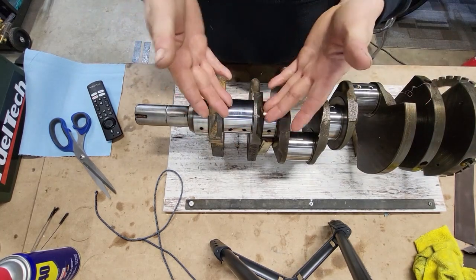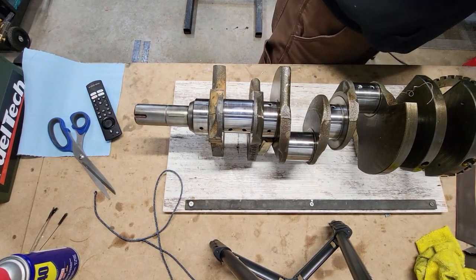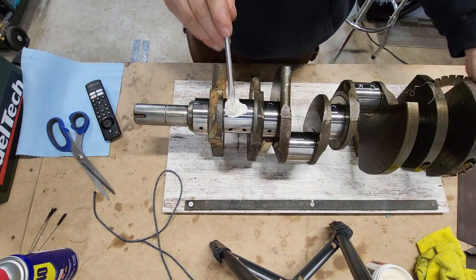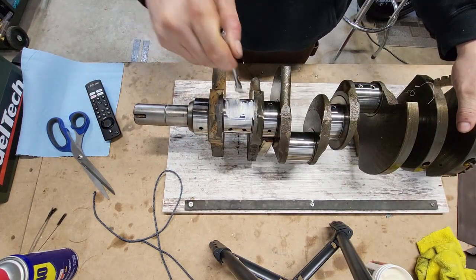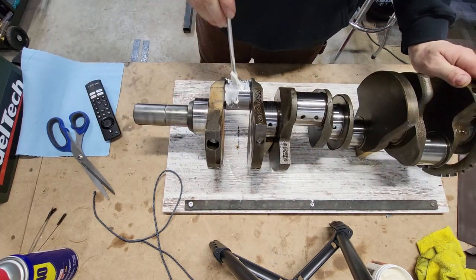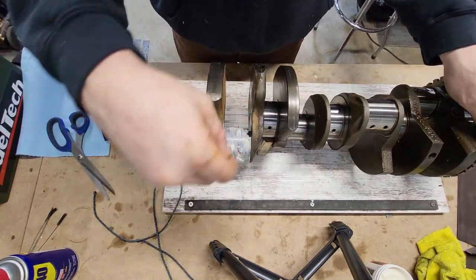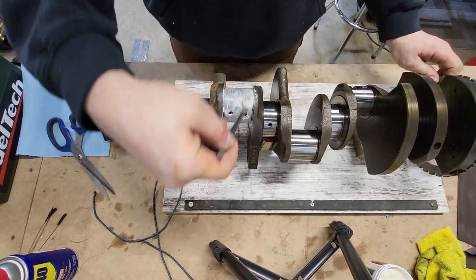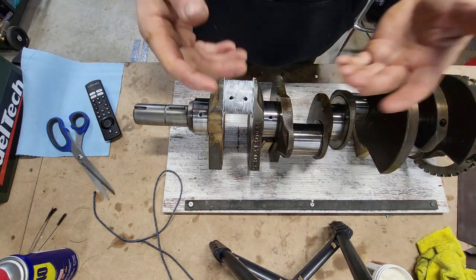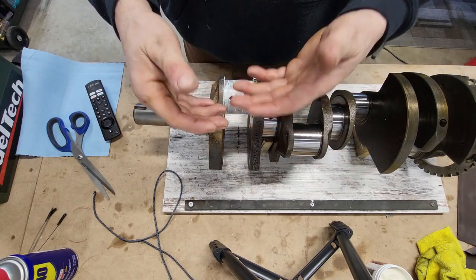Once we've got our journal looking smooth and any imperfections are gone, the next step is to take a little chemical brush and some polishing compound and just brush the whole journal all the way around, side to side. You can't have too much. Get the whole thing covered. Now this is the part that's going to take time, because you're going to do a little bit, then apply more polishing compound and start with another fresh piece of rag, and keep going until you get the result you want. This is totally up to you how much effort you want to put into this.